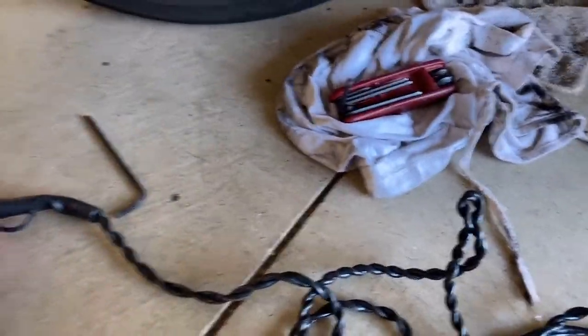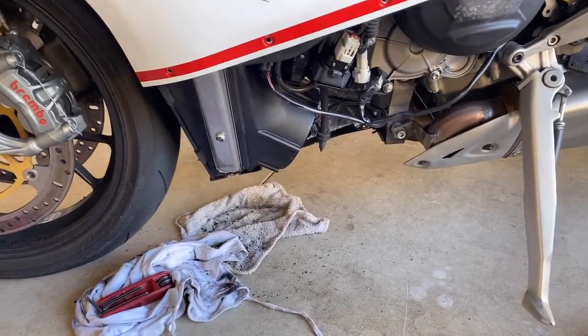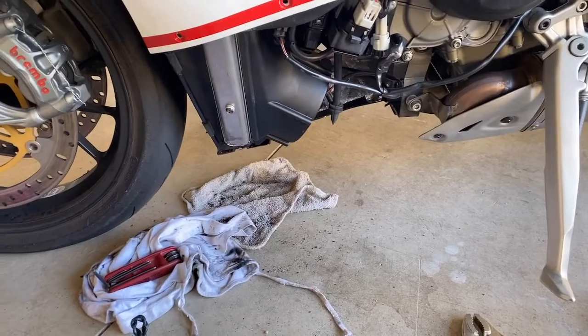Trying to figure out how to get this bolt out. It's taking me way longer than I thought, but I'm playing around with that. I showed you guys previously that it's rusting and all that. It's pissing me off. Oh yeah, and this is the mess. I was hammering it. I tried different things. I tried this PB Blaster, and that didn't work. I have a hair dryer, so I was heating it up. I started the bike and let it warm up for a while, and I heated it up, and then I've been trying different things. I started tapping it with the hammer. Everything except extracting the bolt out, and the epoxy thing, and then I'm about to see if I can hammer and get it turned. But they say it's with the red Loctite. Most of these come stock, but this bike is older, and I don't see the person that had this bike previously putting red Loctite on a radiator drain plug bolt. But that's what we're about to see.